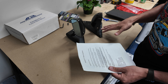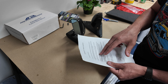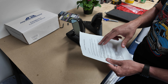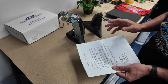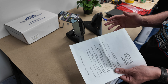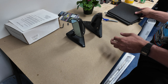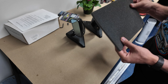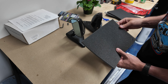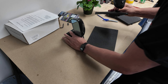One quick thing I noticed before we mount the mirrors to the car — the instructions say to place the factory gasket onto the new carbon fiber mirror billet base. I threw out my factory mirrors a while ago so I don't have that factory gasket, but if I remember right it's just a foam gasket. I don't have any foam laying around besides the foam that came in the box with the APR mirrors, so I'll cut this up and make a makeshift gasket and probably just hot glue it in place.